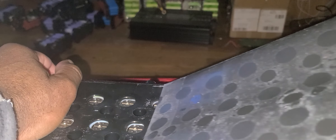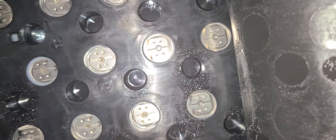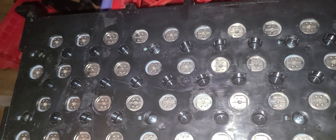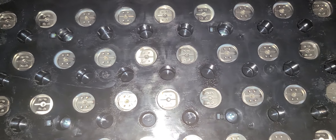You just peel it — it's got a glue. Take the whole thing out. You won't need it anymore — you can toss it unless you want to put it back. The screws will be visible. There's one there, one there, and it goes all the way through. Take all of them off. Then these things will come out. You're going to need something like plastic to push this thing down underneath.